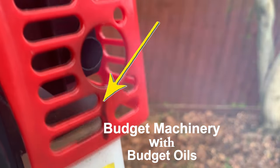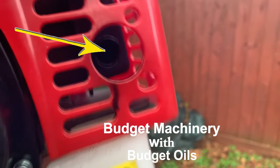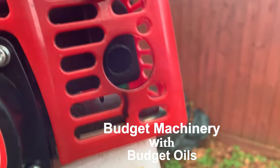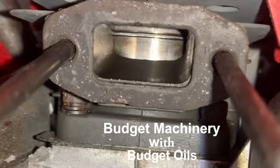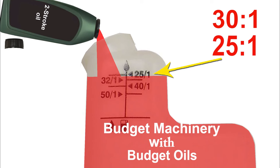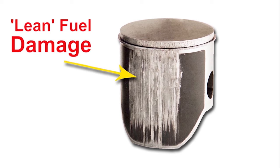To me, that's telling me that there's plenty of oil going through the engine and through the system, and I know there's plenty of lubricant inside. This is only my opinion and the way I do things. But seeing engine wear and piston damage in a two-stroke is a very common thing, and something I've seen many times as a mechanic. Over the years I've had minimal wear damage to any machines I've owned personally, so I know this level of mix works. Yes, you may need to change a spark plug a little more often, but I would rather change a spark plug than have a whole engine rebuild.